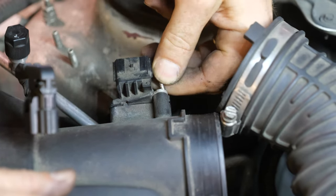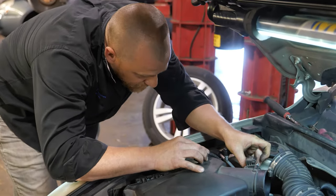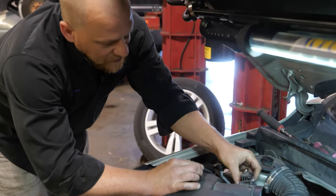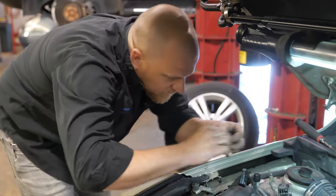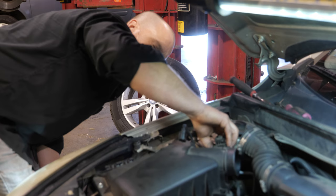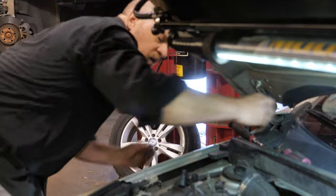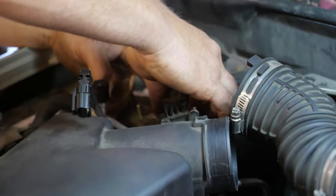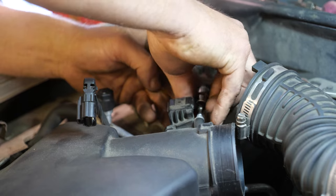This isn't going to fix anything. And honestly, as far as the customer complaint goes, this 10% correction we're trying to get has nothing to do with the stalling problem that was described and the negative fuel trim numbers that were seen. My brother saw like -20, -30% on the fuel trim that was causing the stall. Vacuum leaks don't do that. They give slightly positive fuel trim numbers, the opposite of what he saw. This has nothing to do with the customer's complaint.